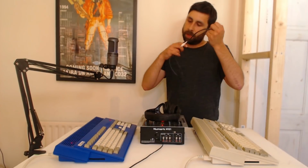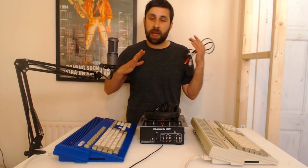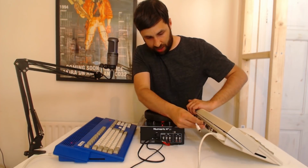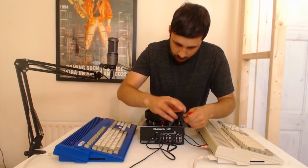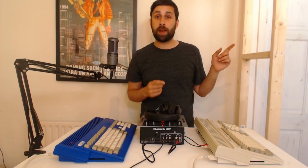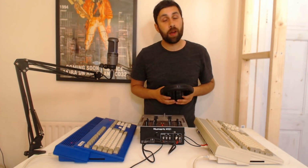Okay, so how do I hook up my Amigas to the mixer? Now this is a lot more complicated than you actually thought. So a lot of people think, oh, it's phono to phono. So I just get my phonos, stick them in the Amiga, stick them inside the mixer, and then we're all good to go. That is not the case because the Amiga splits the audio. Remember, you had audio separation. So left channel you'd hear maybe the drums, and right channel you'd hear the piano. That works in the headphones.